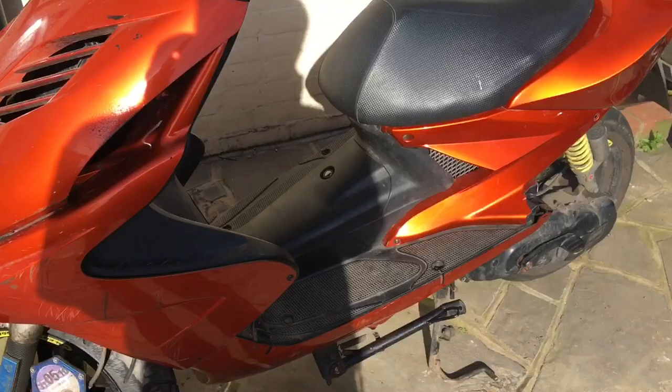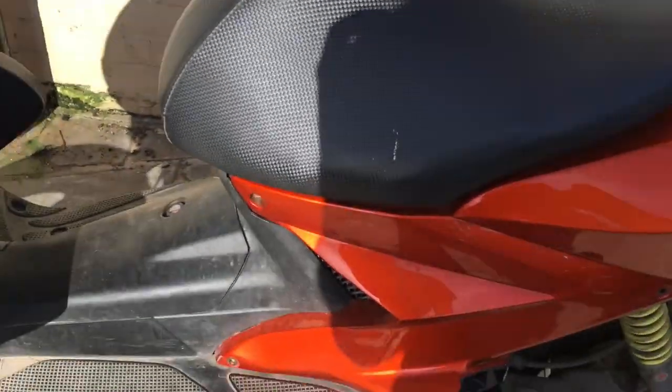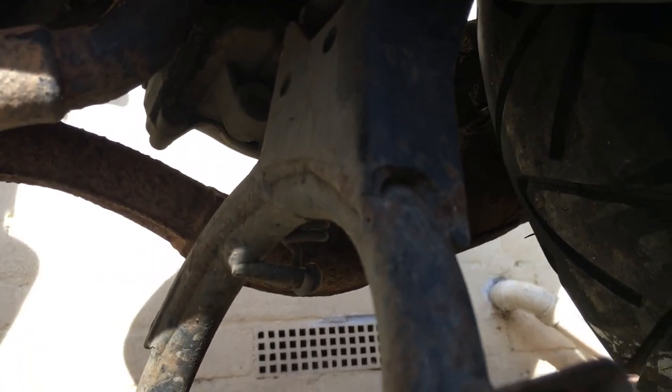You can see at the start where I throttled it, it bogged. After warming it up and starting riding, it won't ride at all. So the first thing you're going to want to do if you're changing your top end is get onto those exhaust bolts with WD-40 — that will definitely help you because these are prone to snapping, getting so hot and cold over their lifetime.